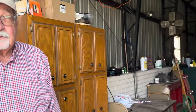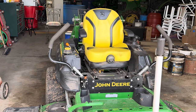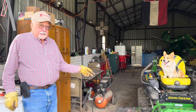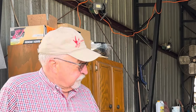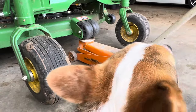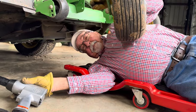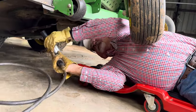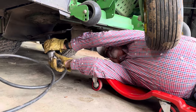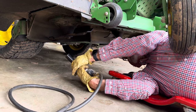The yard needs mowing. The blades on the lawnmower we used down at the park the other day — just to chop up some limbs — so they are absolutely as dull as a fro. We've got to take the blades off and sharpen them so it'll cut the grass in the yard a little bit cleaner. Louie's going to help. I've got to jack the mower up so I can get under the deck to take the blades off. I'm going to use the air impact wrench to take these bolts off.